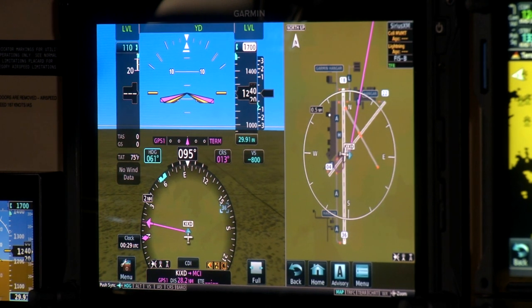There are also a couple of other instruments displayed here that let you remove the archaic non-digital ones from your aircraft. We've got the ability to show a second nav source, outside air temperature, a timer, and a clock. Lots of consolidation into one nice digital display that's going to ultimately last longer, work better, and provide a lot more information for you.